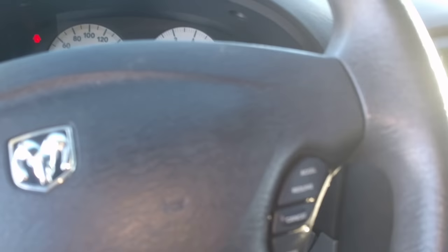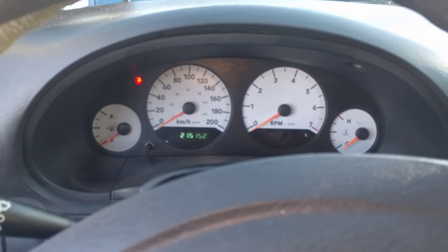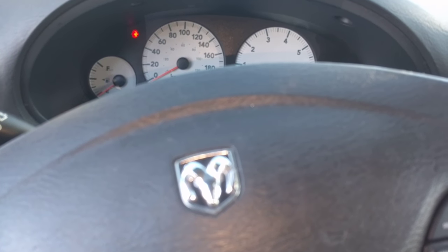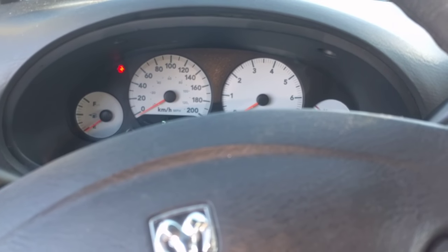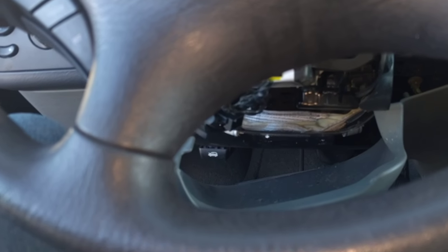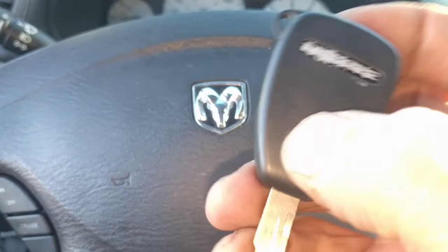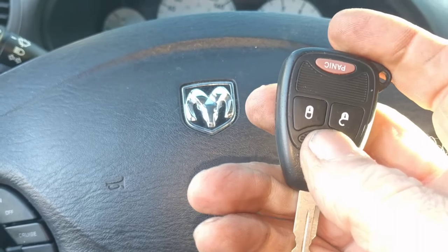The only reason we're changing the ignition switch on this vehicle is because I've already gone through everything else — ignition coil and so on. It's an intermittent stop; not a very common problem with this vehicle, but I have encountered it on some older Caravans. This one just randomly will stop, and I've been driving it for quite some time trying to rule out issues — this is the last item on the list because it has not broken down reliably for me. If you enjoyed the video, please give me a like, add any questions or comments below, and we'll see you in the next video.